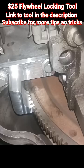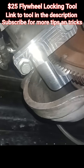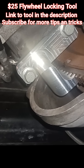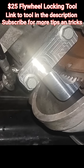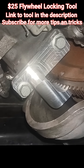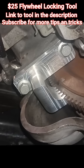I got it in there — it's actually a very nice fit. I was kind of worried at first having trouble getting it sitting flush and getting the teeth in the right spot, but if you can get the bolts started and the teeth interlocked, as you tighten down the flywheel it will turn it. You don't want to tighten it down unless the teeth are meshed, because then you might end up breaking the teeth off the tool. It's tight now and all those teeth are engaged real nice.